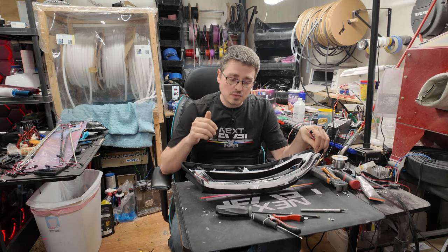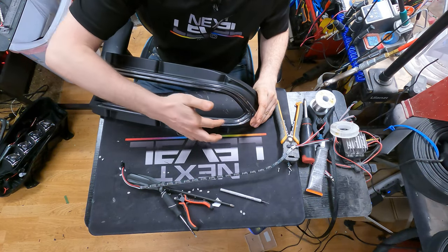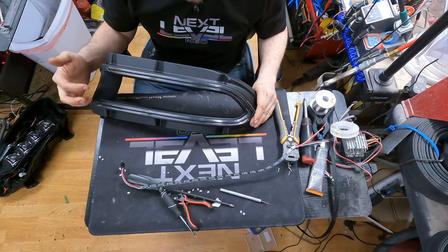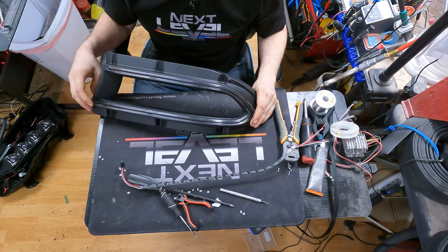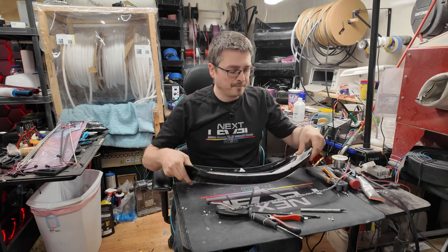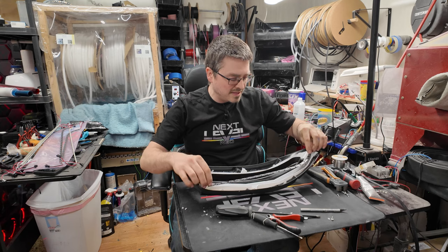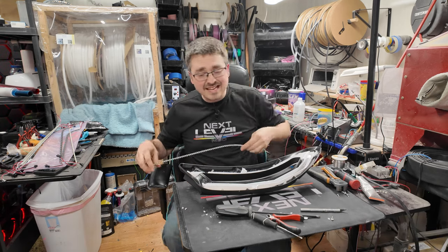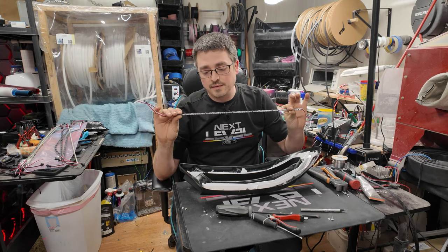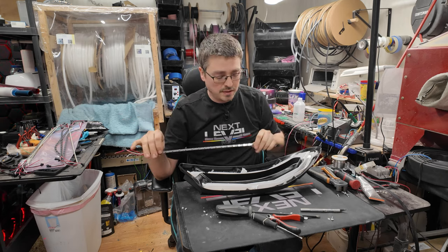But in the case of this, to maximize output, as you can see in the front here, they have almost like two diffusers with a splitter in between. It's like a black section, and it does actually output better and brighter if you use two rows of strips. And while you could possibly get away with using two of these and try to make it work, it's gonna be pretty tight. Ideally, I would go with our straight strips here, and they are cuttable every three LEDs on the back side, and you can solder them to the shape of the panel.